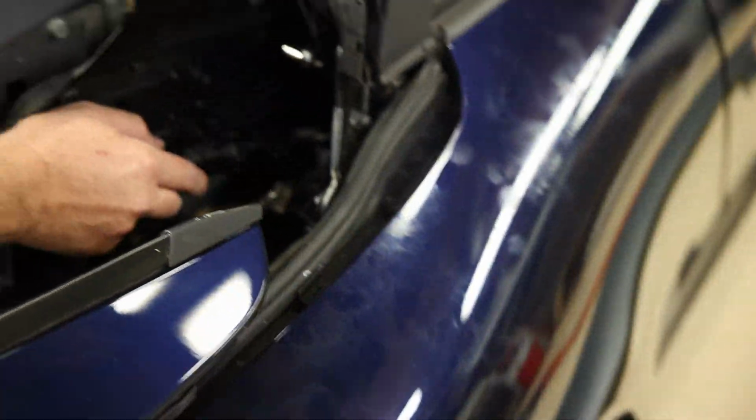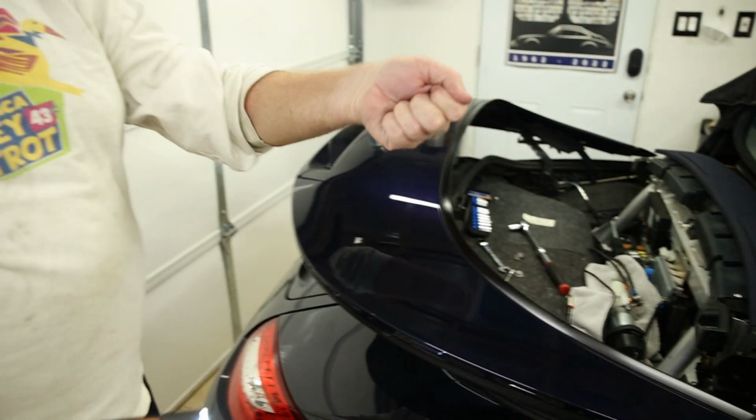So we've got the rod kind of put on the studs here, and the next step is to actually get this pin into that groove there. And you'll need to move the rod slightly up and down to actually get it back in there. As you can see, we actually have the pin in here now in the groove.